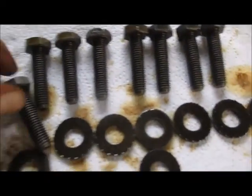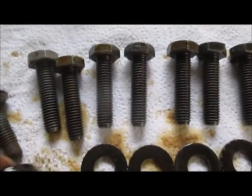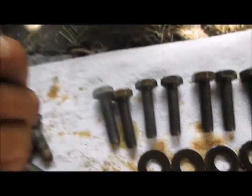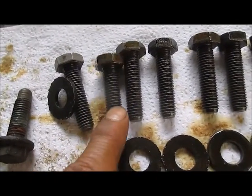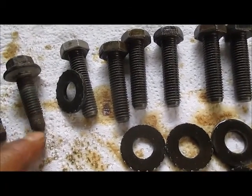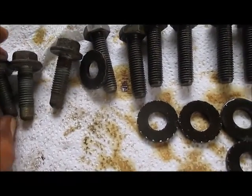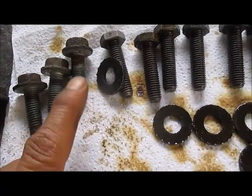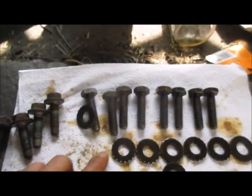This is going to be a little feat. I was trying to put in these screws — they're all clean. That's a whole other thing I did with apple cider vinegar; I did a video on it. These right here have straight edges, and these are tapered edges to go in. These went in a lot smoother than those, and these washers are a lot bigger. The holes that weren't used by the original bolts are really, really crudded or really thin, so I'm going to try to clean them out. More than likely this is going to be a one-time shot — almost like self-tapping ones into those unused holes. Then I'll shoot the others with an impact into the holes that are already opened up.